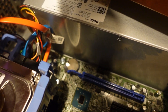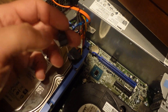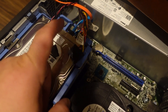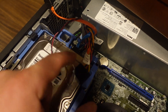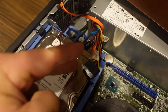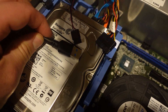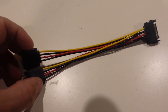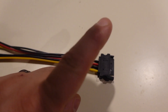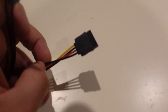I got another power cable. One of the issues I was having — the reason I ended up trying this just to prove that my TrueNAS would work — is I've got a slimline SATA cable and a regular SATA powered cable here. My SSD needs SATA power, so I got a cool splitter. It basically turns this into two SATA powered cables so that I can wire everything in internally and don't have to run it off an external USB cord. This is the power SATA cable — this end goes into the existing cable, and this is going to take SATA power to the HDD and to the SSD.